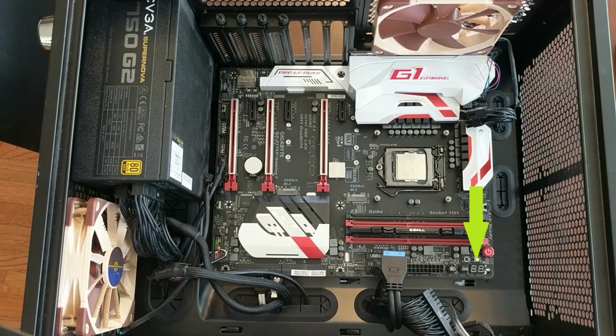I tried one RAM stick at a time in each and every slot to see if any of the RAM sticks were still good, but none of that really worked. The errors I was getting were generally, there's an LED up here showing you error codes, about memory initialization, according to people online, and they always just said, reset your memory, you can get it to work. But after trying 4 different sticks in 4 different slots, one at a time, that never worked. So I don't believe that's the issue in my case.